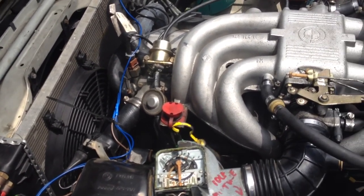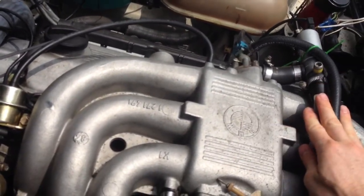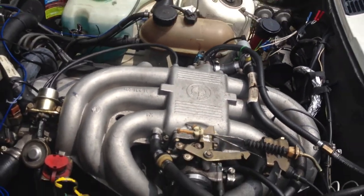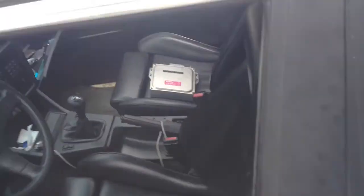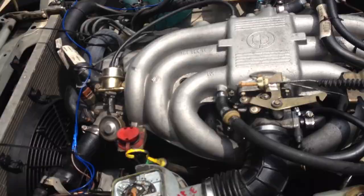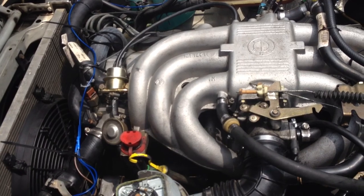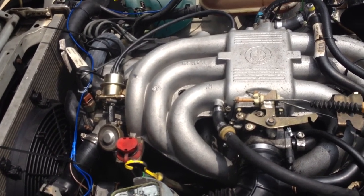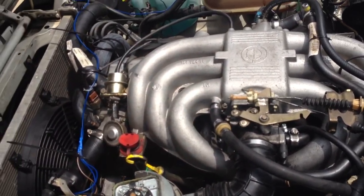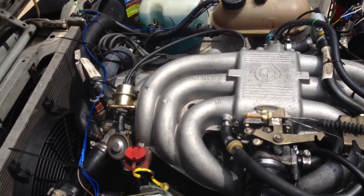Anyhow, I've just pointed out some of the things that made the biggest difference in my car. Also, I got the idle to idle perfectly. Here, I'll start it up real quick. Never mind, I don't have keys on me right now, so that'll be another video. But it idles perfectly. And one thing I did was I messed around with the butterfly in here, just to make sure when it's sealed, I couldn't. I put a flashlight behind the throttle body and made sure that I had the least amount of light showing through the butterfly when it was closed as possible.